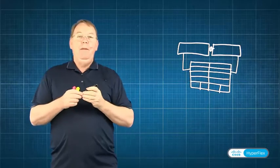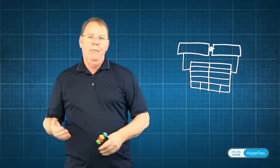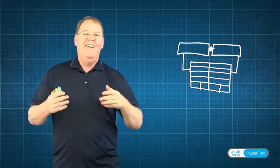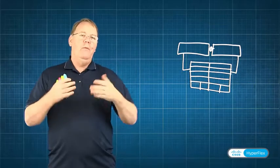And one of the things that allowed us to do this is I took what was the blade profile, the settings of the blade, what made up the configuration of the blade, the firmware, the BIOS settings, all that. And we took that information off of the blade and we put it up here in the fabric interconnects. They look a lot like switches, but they're not. There's so much more. Then we put some software on top of these guys, and we call these fabric interconnects, or FIs for short.